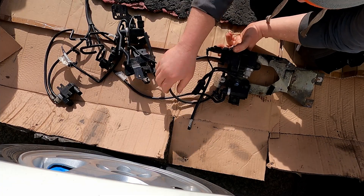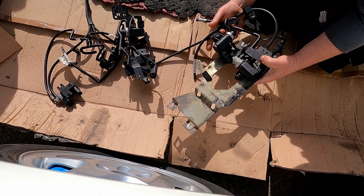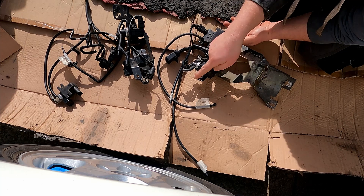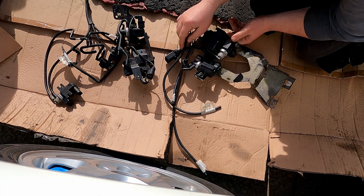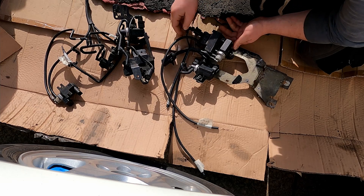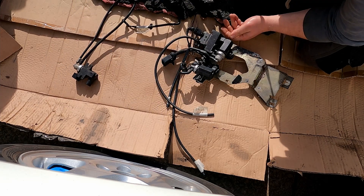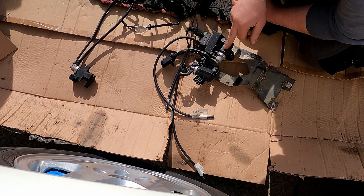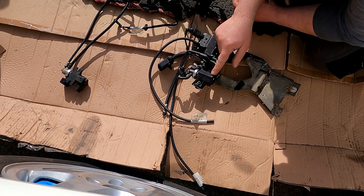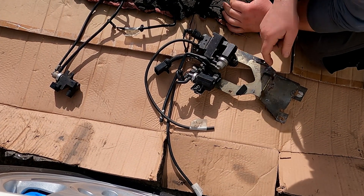The main thing is to label everything. That's going to sit in the engine bay, and that's going to come to the front of the engine. I've got my basic pipes — N75 and N18 and the other one, though they could be swapped around. I can never remember which way around they are — that's basically the EGR shutoff and the turbo one.